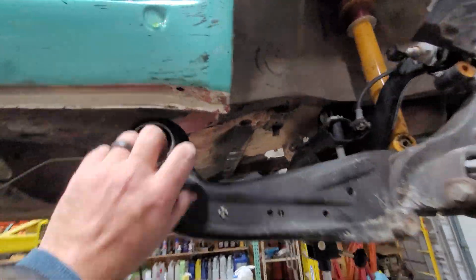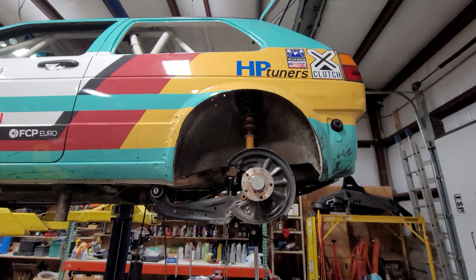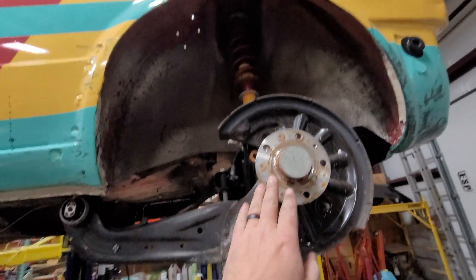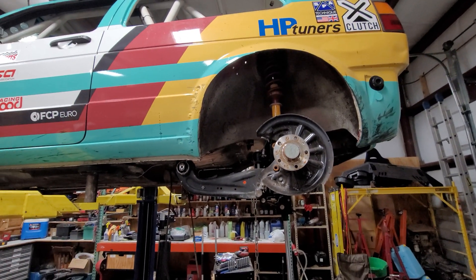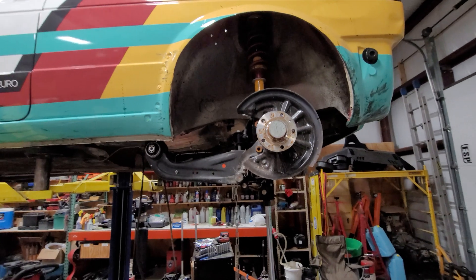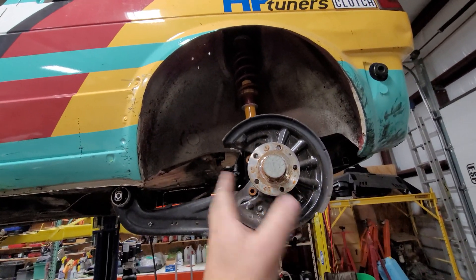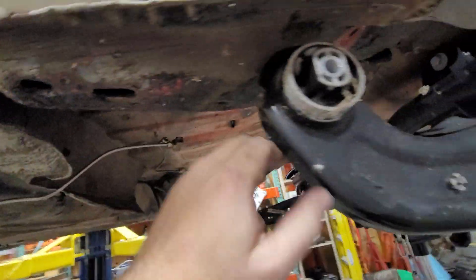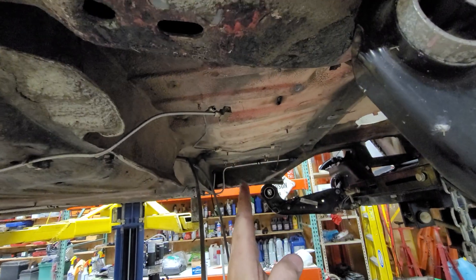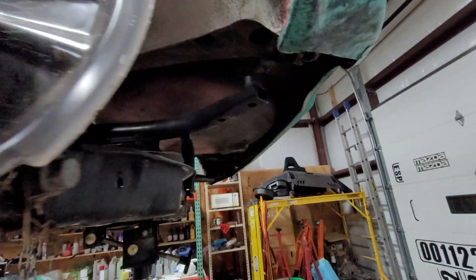I think I figured it out — well, we'll sleep on it. I've got it positioned to where I've added maybe two inches at most to the wheelbase, and again that was more for stability on track. It does move the weight balance more to the front, but I think I could have a little bit more wheelbase and it would be a bit more stable. This is the structural part of the car — this is where the old subframe mounted. It looks to me I should be able to cut this straight across the chassis, box it in, and tube it. This will be the starting point — this is the first pickup point, and I've got this guy with a 5/8 bolt sitting in that.